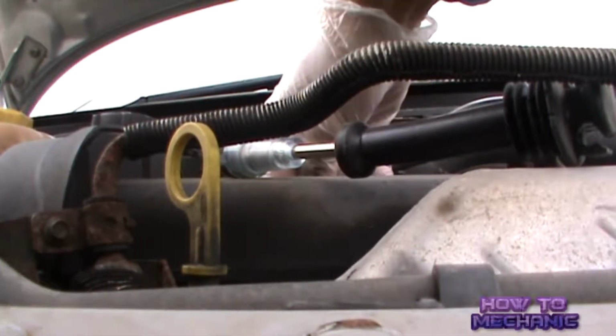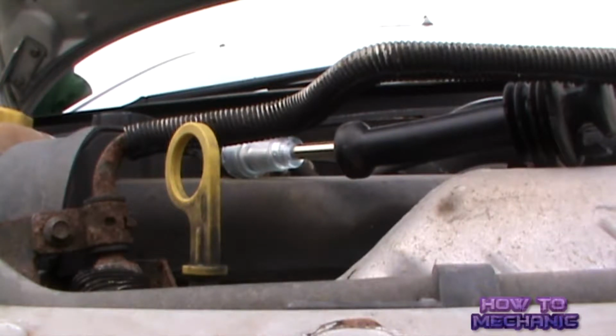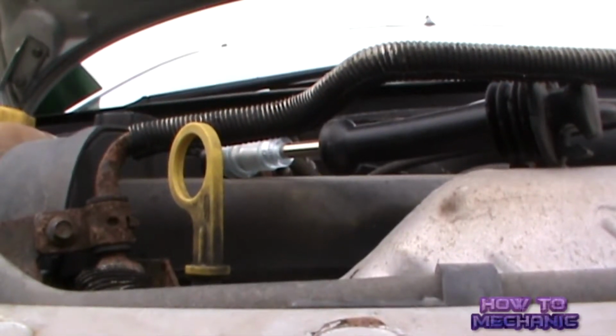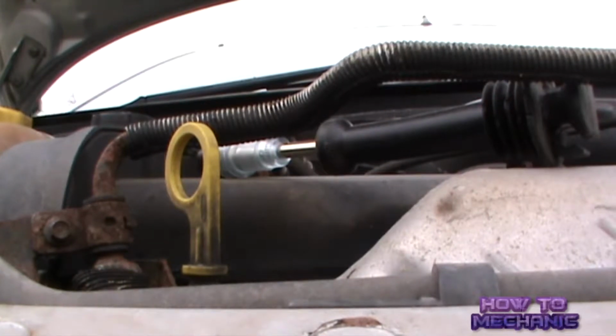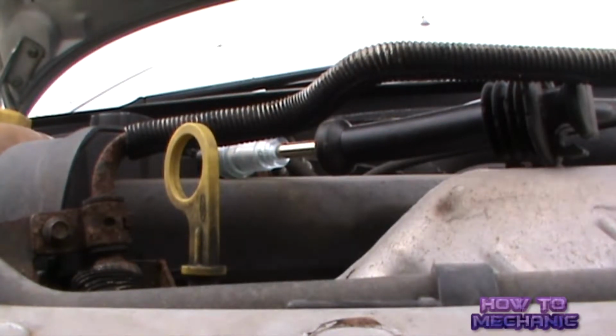Make sure it is securely connected. With this one you need to start up the engine. Now watch out for the test light, it should glow red to indicate there is voltage going through from the HT lead up to the spark plug. Actually glow.